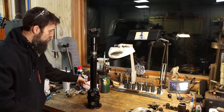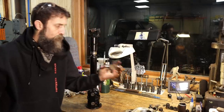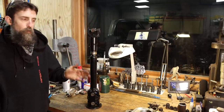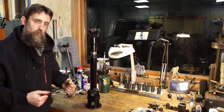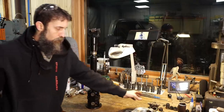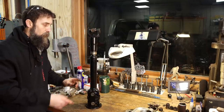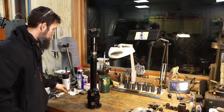We went with the Spicer joints down low here that are greasable, because if I have an option, I always pick the greasable type. If you're running heavy water or deep water, or running mud, you can go in there and pump some grease into those joints and force any water or grit that gets in them out. With the non-greasable ones, you don't have that option, so they tend to last shorter. They all wear out, especially if you pull heavy loads, but the greasable ones, for me anyway, seem to last twice as long.